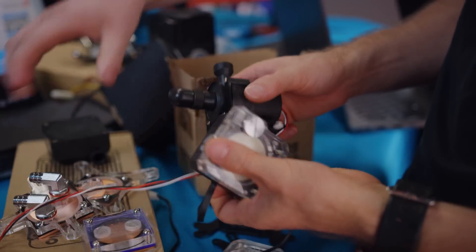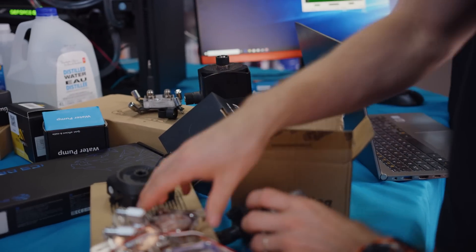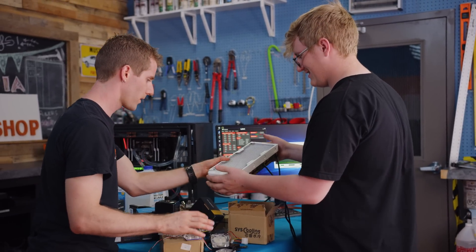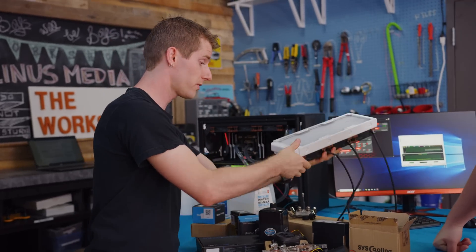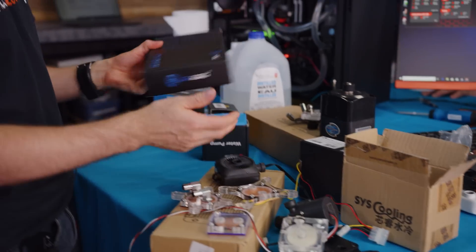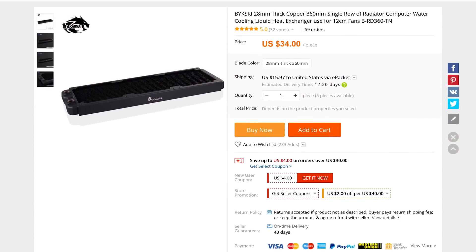These two are basically the same just with different tops. You see this a lot when you order stuff from China — designs that are clearly borrowing from each other, or straight-up produced at the same factory and rebranded. It turns out these radiators are actually aluminum. Heads up: you don't want to mix metals. Aluminum plus copper equals corrosion. The good news is we followed up with copper and brass radiators with just aluminum fins that don't touch the water, for about five bucks more. Even if you're going the AliExpress water cooling route, spend the extra five bucks.